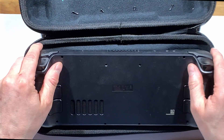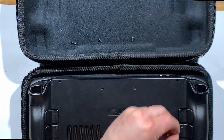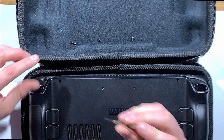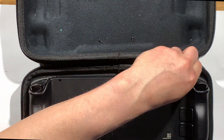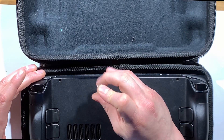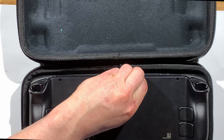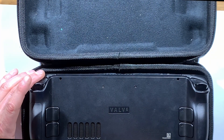I have a little trick when putting the back screws in: put them in a diagonal crisscross pattern. The reason is that if you tighten all one side first and then work your way to the other, you could over-tighten one side and make the holes on the other side hard to align. Going top-right to bottom-left makes things tighten much more evenly. And that's the hard drive installation. Make sure to keep watching for the operating system installation coming up now.